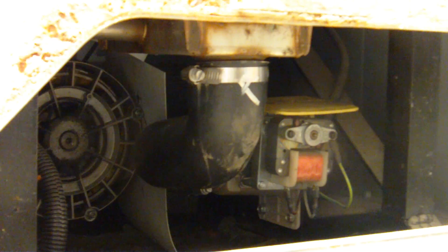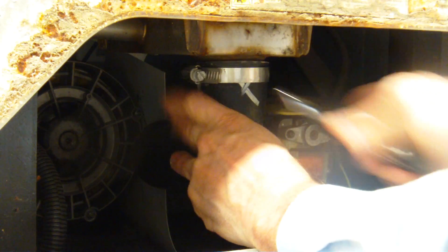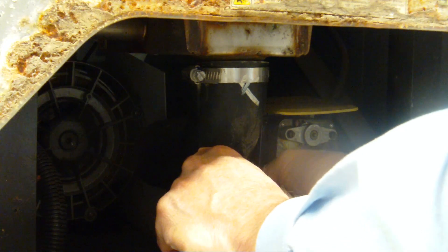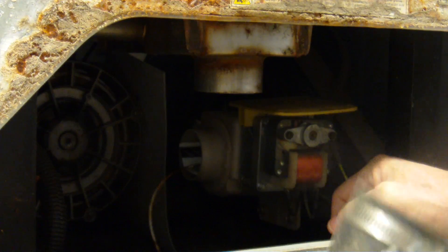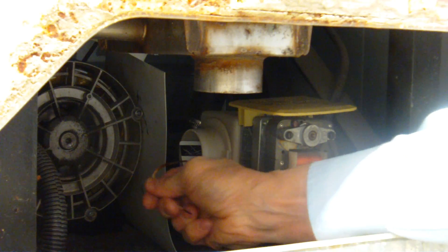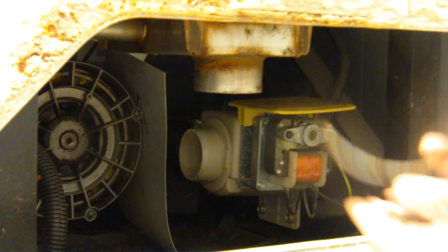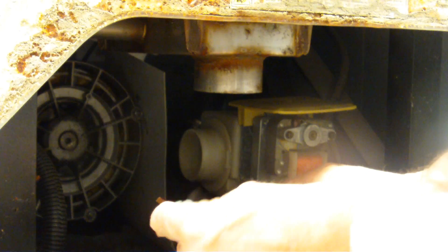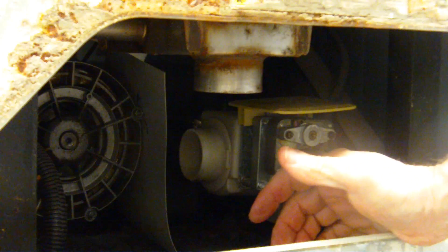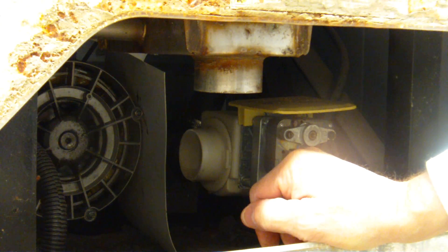What we've done is we've taken off the front panel. We're going to loosen the drain hose clamps. It's clean there, but you can see that we've got a laundry card and a bra wire. So that was our obstruction that was holding the drain valve open. With the drain valve open, water would flow in and out just as quickly, and so it wouldn't accumulate in the drum, causing the EFL error.